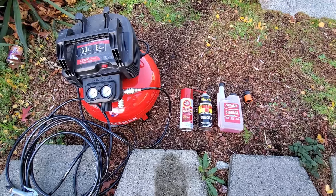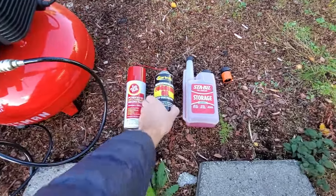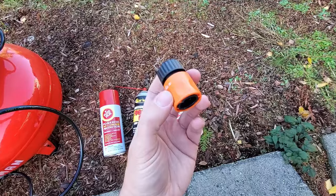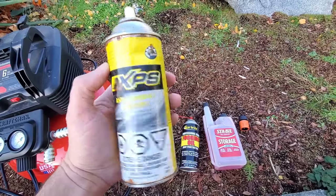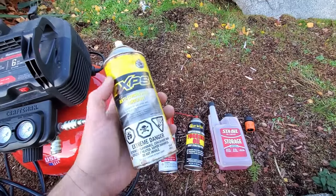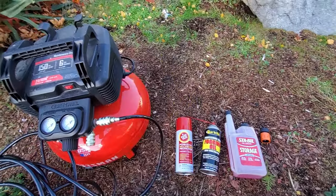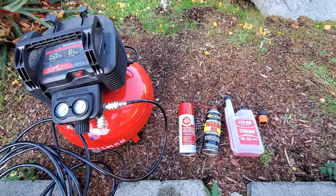To do this job I use these items: a little pancake air compressor, some rust and corrosion protection, lubricant and penetrant, some professional grade fogging oil and Sta-Bil fuel stabilizer, as well as a hose adapter kit which will allow you to run your jet ski on a hose when it's outside of the water. If you want to spend a lot of money you can buy name brand BRP — that's Sea-Doo's brand — anti-corrosive lubricant or fogging oil, but it's like $25-$30 a can. This stuff is about $10 a can and it's the same stuff. I'll put links below to where you can purchase them on Amazon.